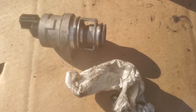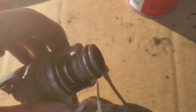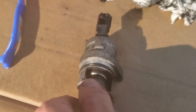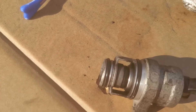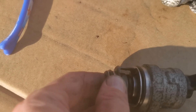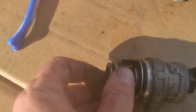If you have an old toothbrush you can scrub out in here and clean all this carbon up. I also took a Q-tip and cleaned a lot of the carbon off up in here because there was a lot caked in. There was a lot of carbon caked up in here as well as up in there. Here's how the valve goes — you can see that moving in the middle right by where my thumb is. When this allows air, the valve will open and allows air to get in there. At idle it'll work so long as you can see where I push it goes up, when I let it go it goes back down — as long as that's sealing, you should be good to go. If not, obviously replace it.